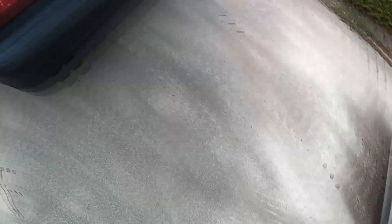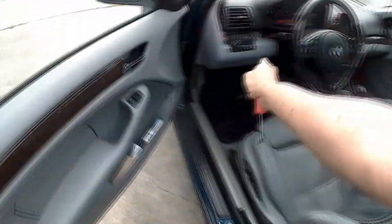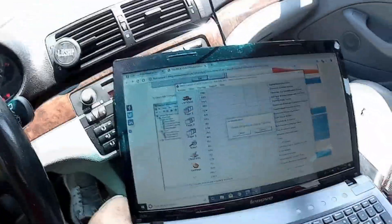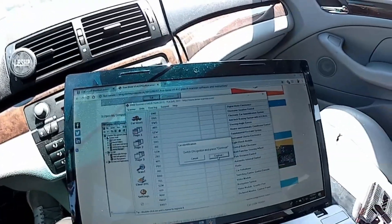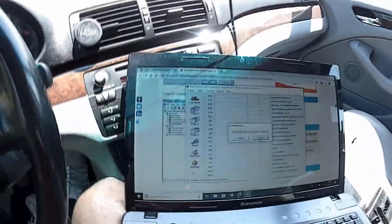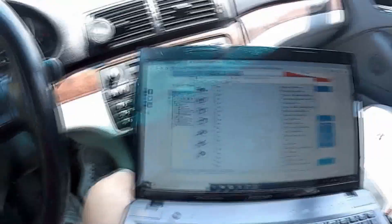Let's just see if the LCM works. If you press a button the fog light is supposed to get brighter — I can't really tell if it did. Now the fun part: you've got to code it with a form of BMW scanner. PA Soft is usually an easy one to have — you can download this online or buy it from eBay. You plug it into the car with the cable that you have to get from usually eBay or another source. This doesn't use the usual OBD2 cable. Click continue when the car is on — I have it started so I don't kill the battery. Continue — now it's going to go scan through things.